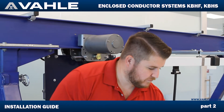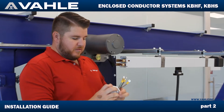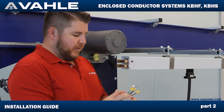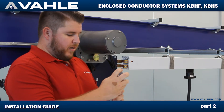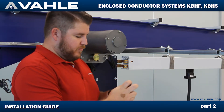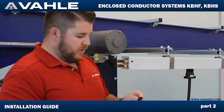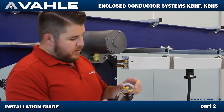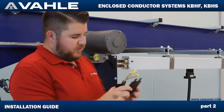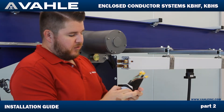Next, you're going to take your wire and remove this nut. You're going to take your gland, take all four wires, put them through here and feed them through the end of this. Feed your nut over the top of your wires, and then start putting on your hex nut to hold in your gland.